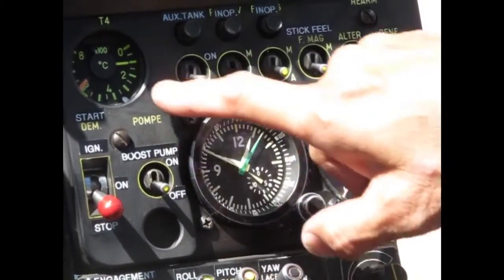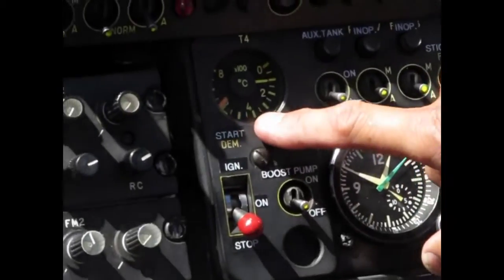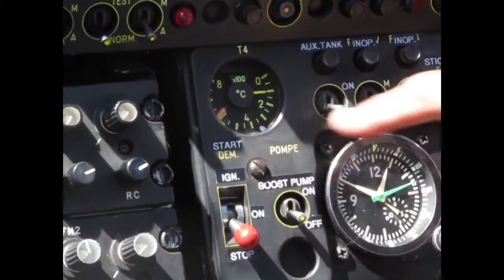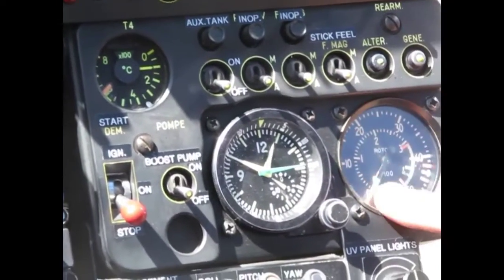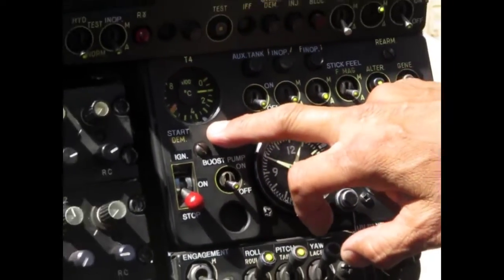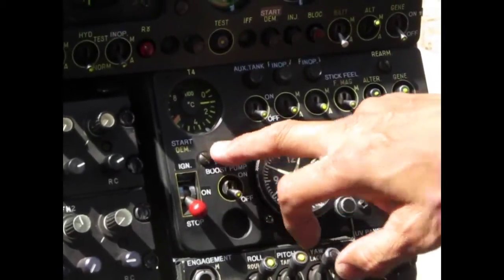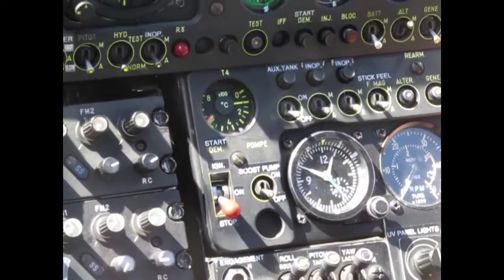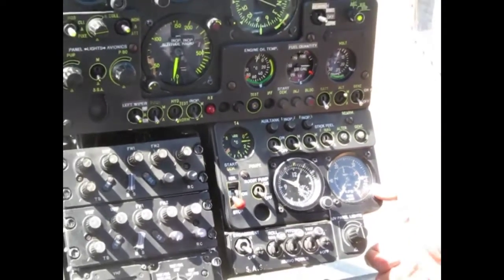So why is this? Once it synchronizes, the temperature would drop probably to about 375. Everything stabilizes — the temperature below 400 — and then you can continue slowly advancing the throttle all the way to the top of the green.